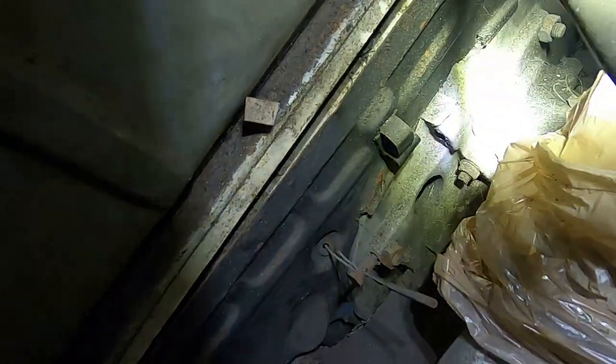The wife had it. I disconnected all of the wiring from the solenoids and everything, the starter as well. I do have to get down to these two bolts, one right there, one over there. I think those are the last for the transmission mounted to the engine. I'm not 100% sure, but I think so. Let me show you what's going on underneath, though.